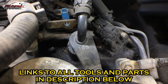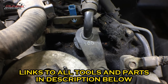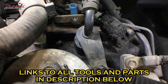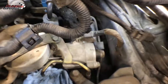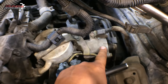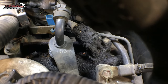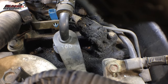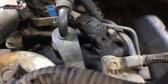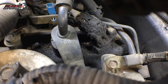Right here on the very top of the transmission is where you actually fill the transmission up with ATF. On most vehicles, on most J-series Honda V6s, it does not have this system set up. The reason it's set up this way is because this flows back into the transmission — it goes from the transmission filter, into this line, and gets dumped right back into the transmission. This is the quickest and easiest way to fill up the transmission. To drain all the old fluid out as much as possible, you can drain it three times — drain it once, run 50 miles, drain it again, run another 50, drain it again, then fill it up.